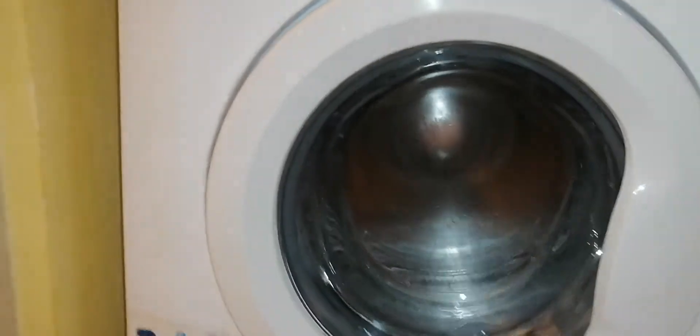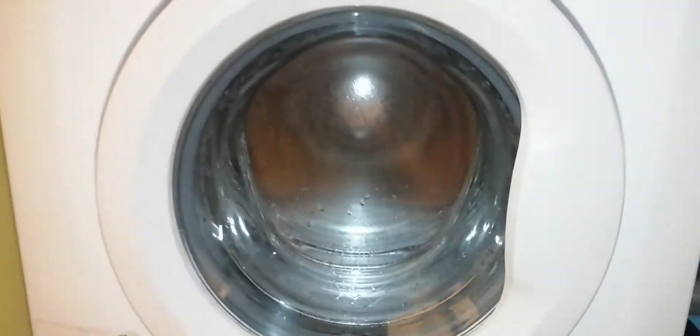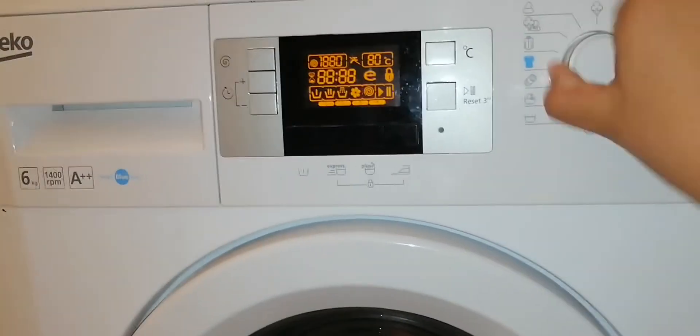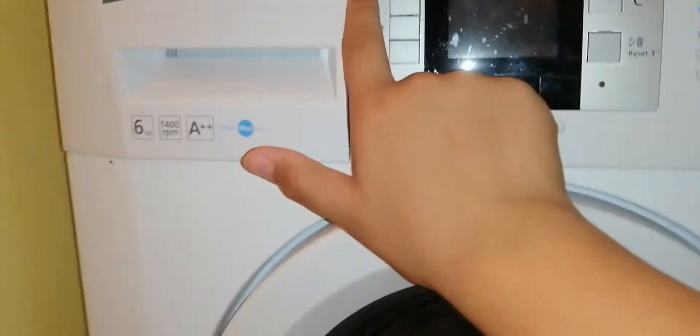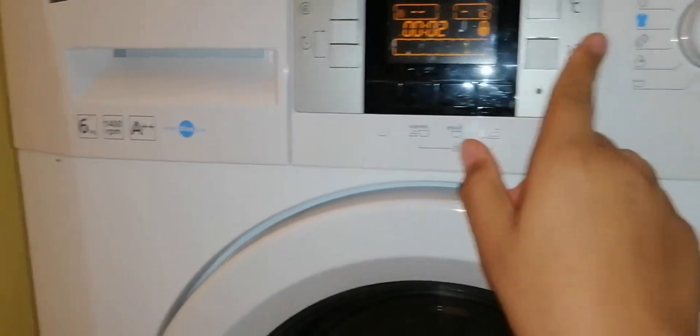You can see how much water splits at 1400 or 1500 RPM. Putting the machine to drain, stopping it, then putting it to drain only — it drains correctly. This confirms the machine has a correct drain with no blockages on the water outlet path.